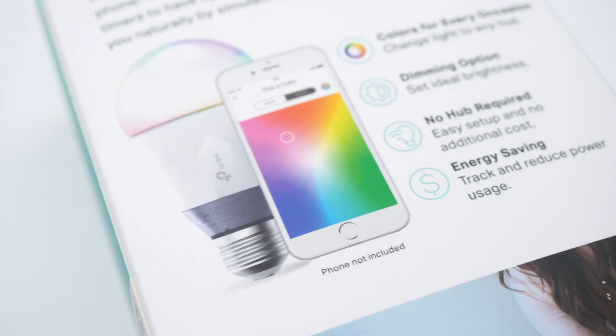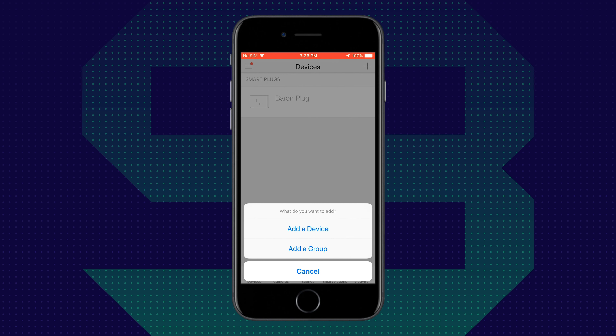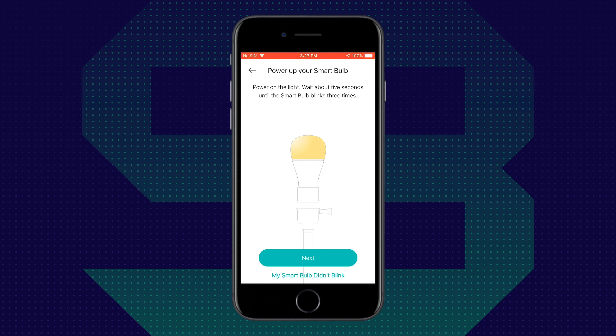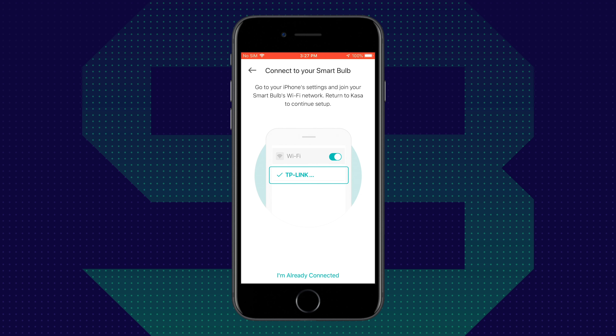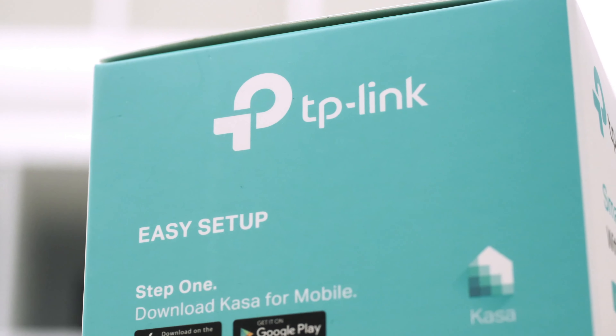Now that we've gone over the design and feature set, let's talk about the installation experience, which is honestly quite easy and straightforward. You're going to want to download the Kasa app on your mobile device and make sure you're on your home's network — the same network as your TP-Link Smart Bulb. Go ahead and plug in the smart bulb. Notice there's no hub around; I don't have to fiddle with that. Just directly put the bulb into your lamp connected to a router. From here, go to the mobile app, tap the plus sign in the upper right-hand corner, tap Add Device, pick bulb, and it walks you through the installation process. You'll put your bulb on your home's Wi-Fi and you're ready to go. Considering this hubless design, you'll be done with the entire process in fewer than three minutes.